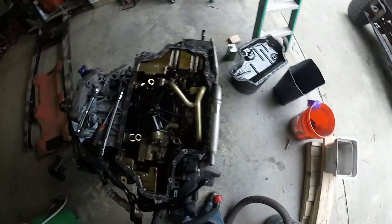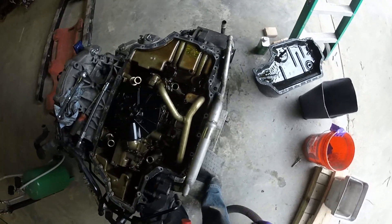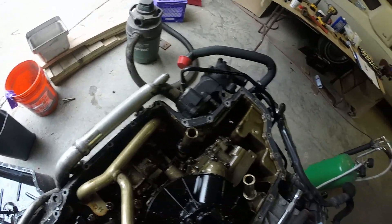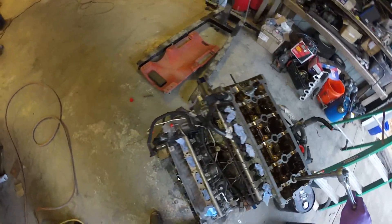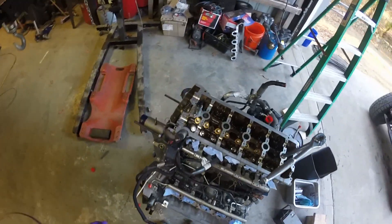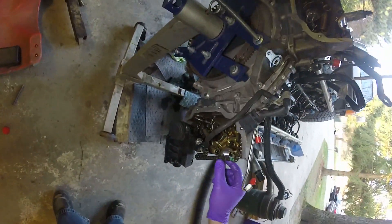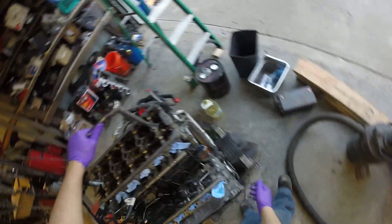I don't think enough coolant, when I had the engine over, would have slipped through this hole here — which is the oil dipstick tube. But then the question is where does that oil come from? It's kind of all over here. I'm going to send out a sample of some old oil to have it analyzed just to see what's going on. If the engine oil comes out good, there's no point pulling it. After discovering coolant in the oil, I'm going to remove all the spark plugs and see if there's any showing a clean tip — if so, then we have a suspect cylinder.